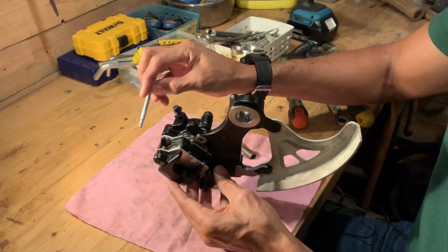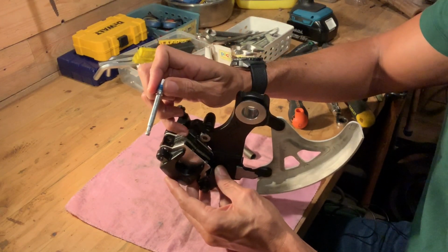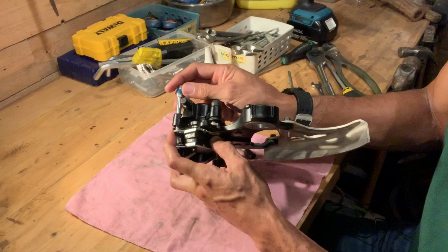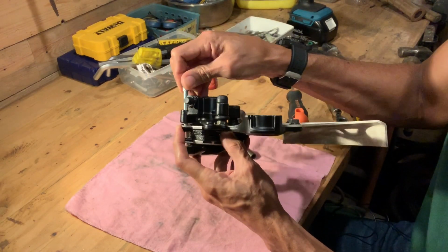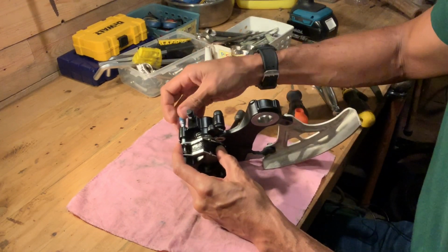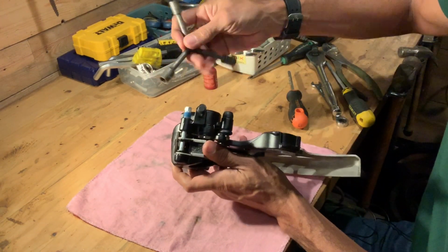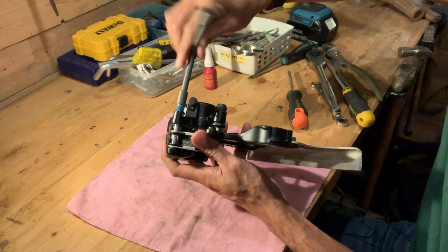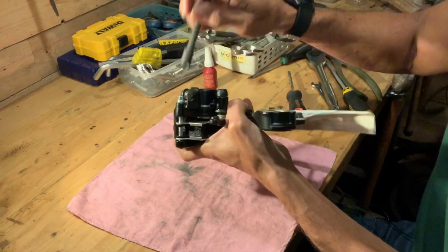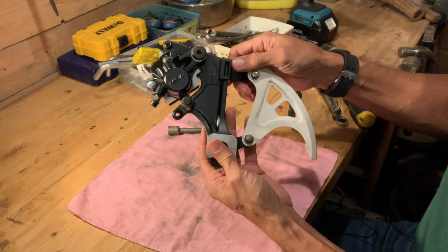Now our brake pin is lightly greased. We've also got a little bit of grease on the back of the brake pad that makes contact with the piston just to avoid any brake squeal. So we're pushing this pin through our brake pads underneath the spring clip retainer. And that's just going to thread through. We've already got a little bit of thread locker on there, and we're just going to snug that down. Check our alignment. That's looking good. That looks sweet.